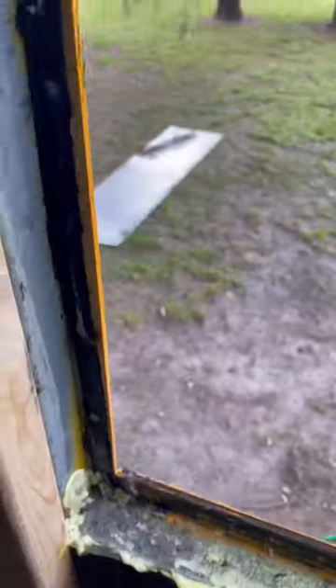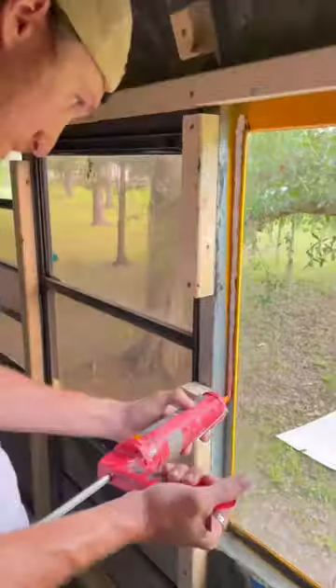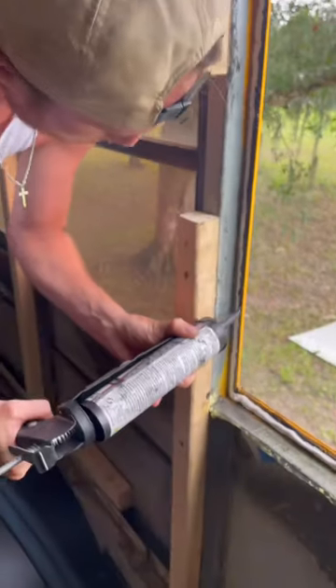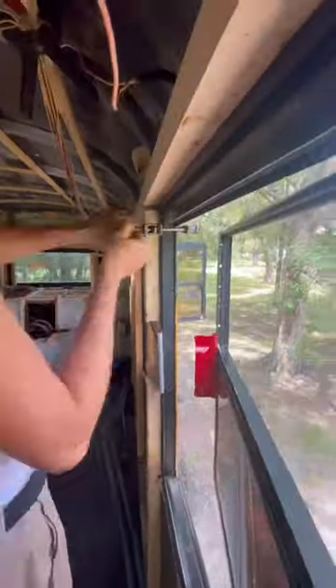While I was scrubbing away, Paul continued redoing all the window seals. This transformation is a little hard to see but we removed all the old adhesive, and with the seals clean we could reinstall the window. We used both construction adhesive and caulk to be extra safe, clamped up the window, left it to dry overnight, and the next day we were finally leak proof, which was a huge relief for us.